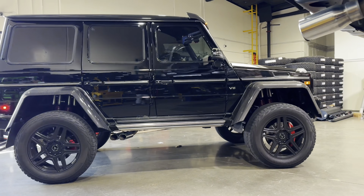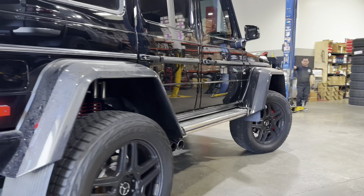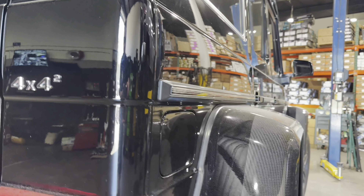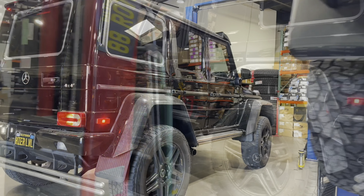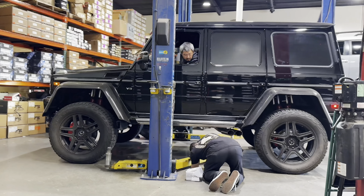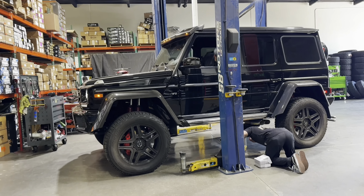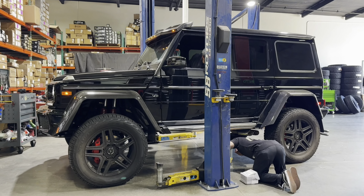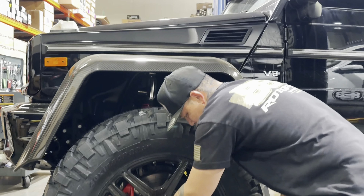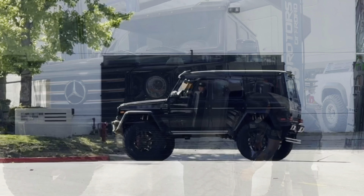If you have some time, we're going to throw in a G-Wagon 4x4 Squared. We're doing 40-inch tires on the factory wheels here — running the 40-15.5-22s on the factory Mercedes wheels. These 4x4 Squareds come with about 18 inches of ground clearance out of the box with the factory portal axles — that's ridiculous, in a good way. But after today, a slight adjustment of the coilovers and ditching the factory 36-inch tires for 40-inch tires will get about 21 inches of total ground clearance. Don't you wish our Toyota trucks got that much clearance?